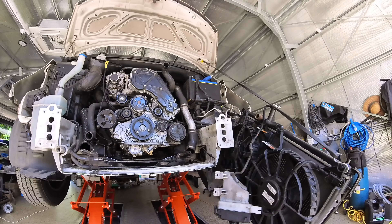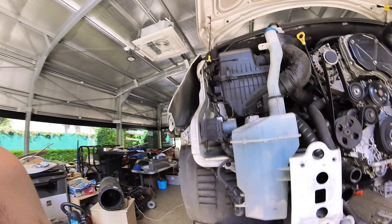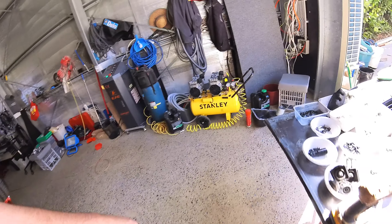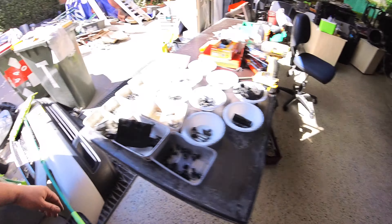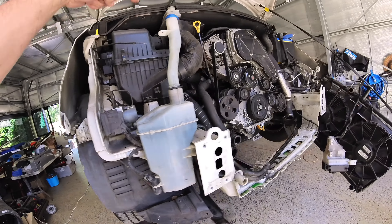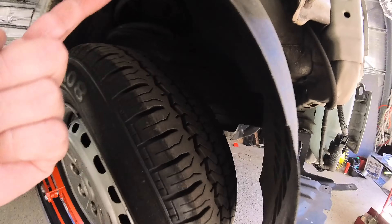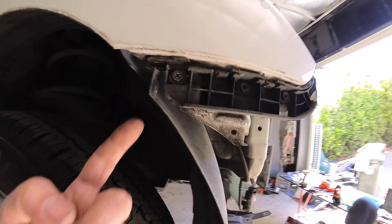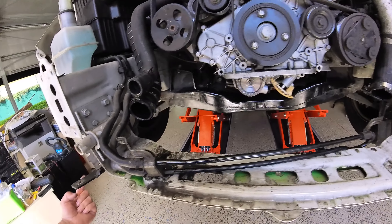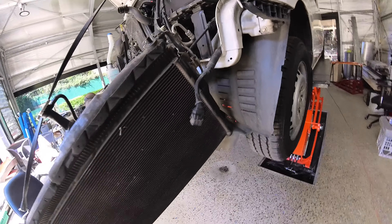To get this front part out - it is what they call a cassette - you have to remove the bumper bar. I'll show you where all the screws are to make it easy. Remove the bumper bar: you've got plastic screws that go all the way along the top, then you've got one under here and one on the other side in the same position. Then you've got plastic clips that go all the way along the front. You can just prise it out and wiggle the bumper bar off.